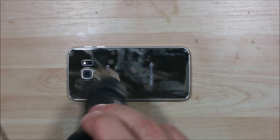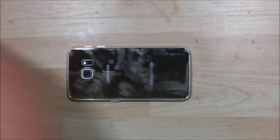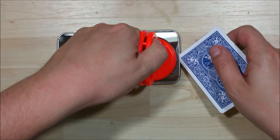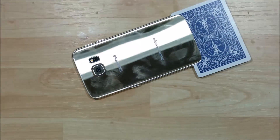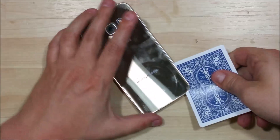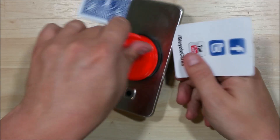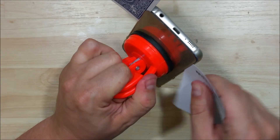This can be a little bit tricky depending upon the device. I've done one that was really hard to remove, and a few that didn't seem extremely stuck. Going to go ahead and put our suction cup on, pull it back — it is nice and warm. You can see it's starting to separate. Go ahead and slide our card in, pull the suction cup off, and work our way around. If you get stuck, you can use the suction cup to help you as well.